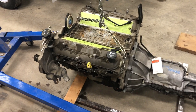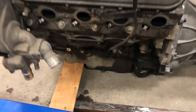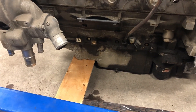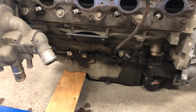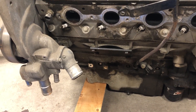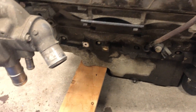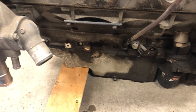The next step is to get the engine sitting exactly where you want it. This is going to take some finagling because you need it to sit there without engine mounts. For us today, we have a nice flat oil pan and a couple pieces of wood, and we're mounting it to a square frame, so it's pretty easy. But in the real world, you may have to make a little fixture to temporarily hold the engine, maybe by some bolt holes on the front of the block. I can just put these pieces of wood underneath and it's staying level front to back, side to side.